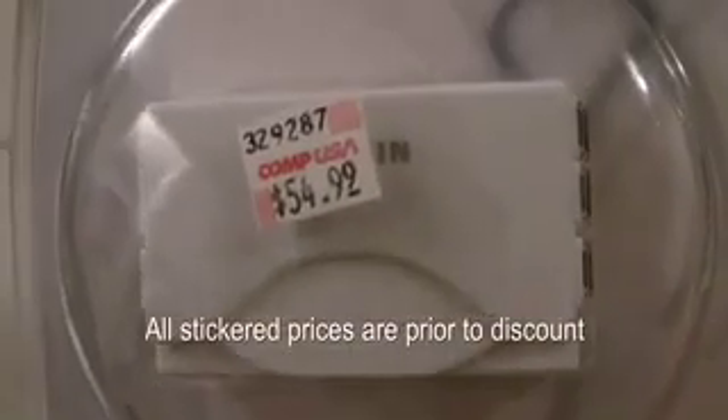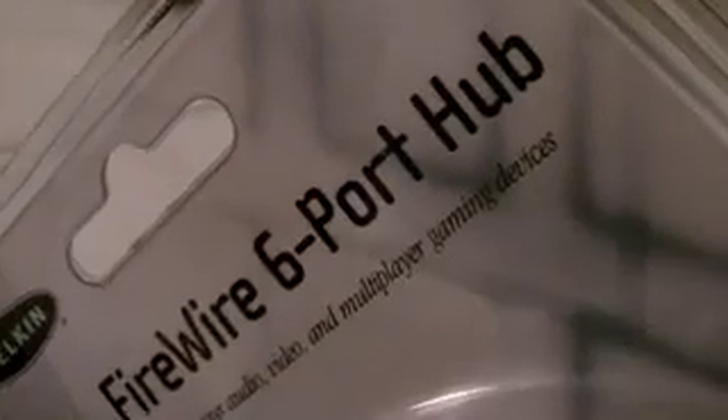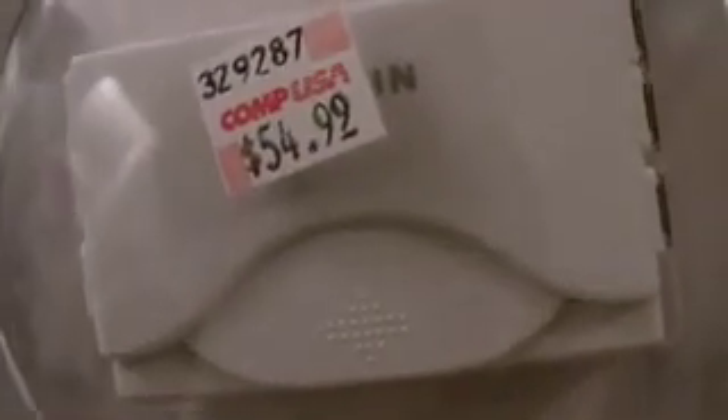USB 2.0 thumb hub — it's a really small hub and it has a power pack, so it can be used as a powered hub, and that's going to go in the back of the G5. The use of this device is so I can use it as an extender. I'm hooking up a new piece of audio equipment, and it's FireWire-based, and it's just too far away from the computer. So I'm going to use this as a powered repeater to extend the power so I can hook this device up. And here's a really long FireWire cable as part of that equipment setup.